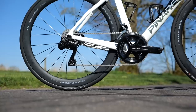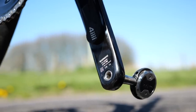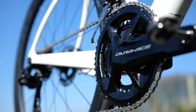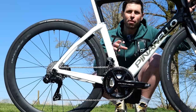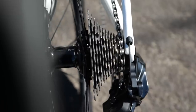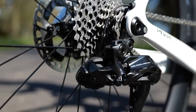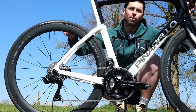In terms of the rest of the groupset, the cranks are 170 millimeters long, which is a preference of mine from my days of racing. The chainrings are a 34/50, which is okay, but I would prefer to have a 36/52 if I could - I just prefer having that extra bit of gearing. The cassette is an 11-to-30, a balance which I think is really good between the range of gears you have and the jumps between the different gears themselves.